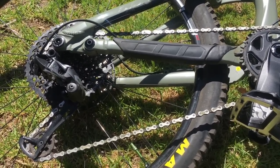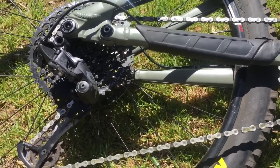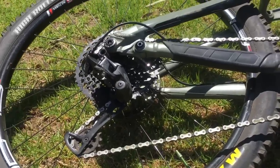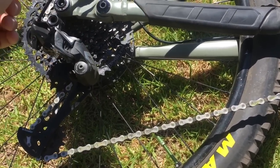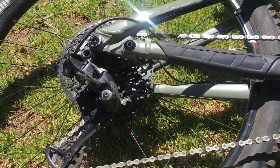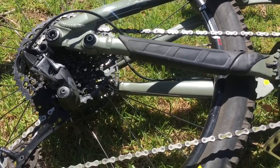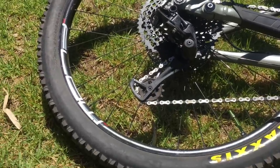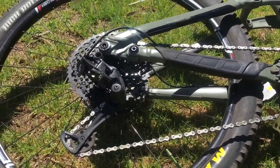I spent a few days on it so I've got a fair idea of how it works. At first my impression was it was really rattly and I thought maybe the clutch was gone. Now this is my Patrol — it's got the GX setup. What was actually happening is on the other side of the rear axle there's a removable Allen key tool to undo the axle, and that's what was rattling around making the back end noisy. There was also very low engagement in the rear hub — 18-point engagement — which makes it quite slappy. Taking those factors out...